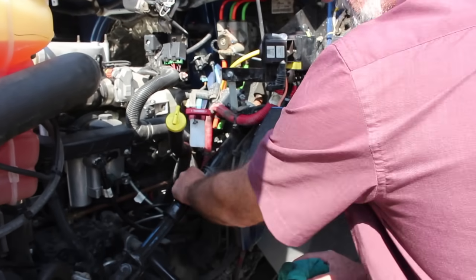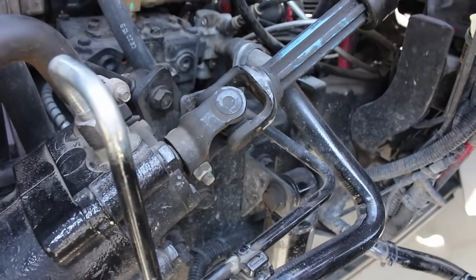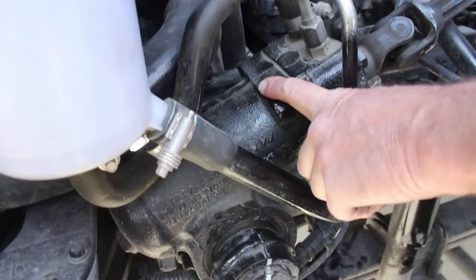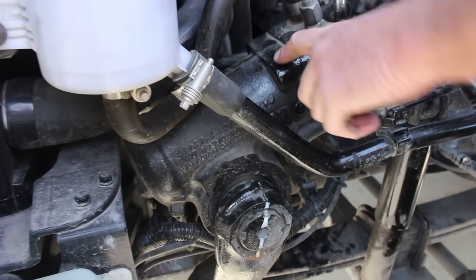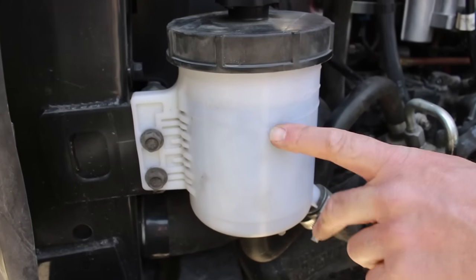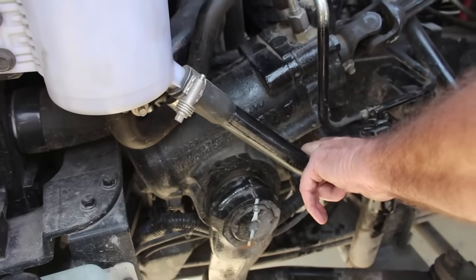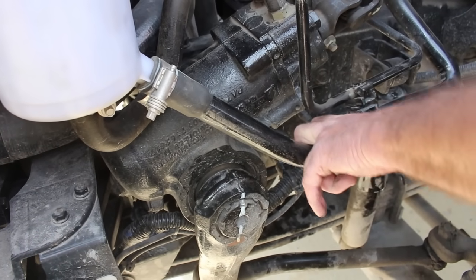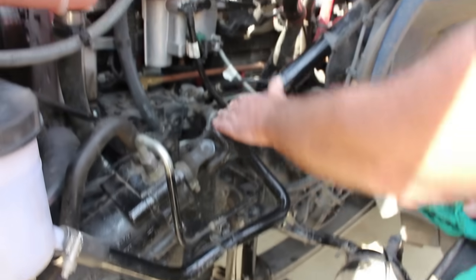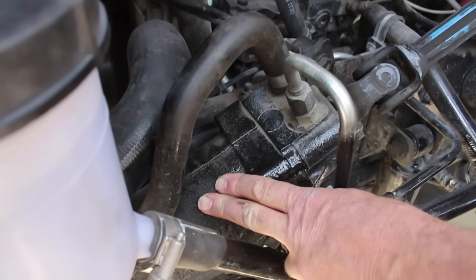Moving on to the steering column — it must have less than 10 degrees of travel and is securely mounted, not cracked, bent, or broken. The steering universal joint is securely mounted, not cracked, bent, or broken. My steering box is securely mounted, not cracked, bent, or broken. My power steering level is above add and below full — within operating conditions — and the container is securely mounted. The hose from the power steering container to the pump is securely mounted with no signs of abrasions, bulges, cuts, or leaks. The high pressure line and steering box are securely mounted, not cracked, bent, or broken.